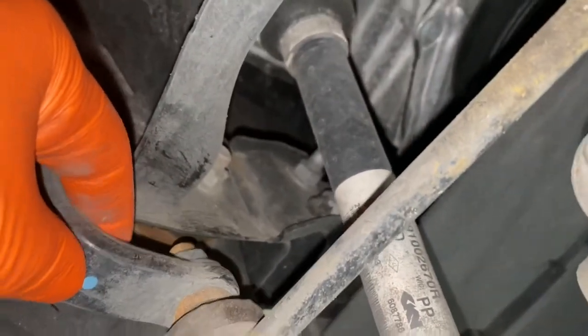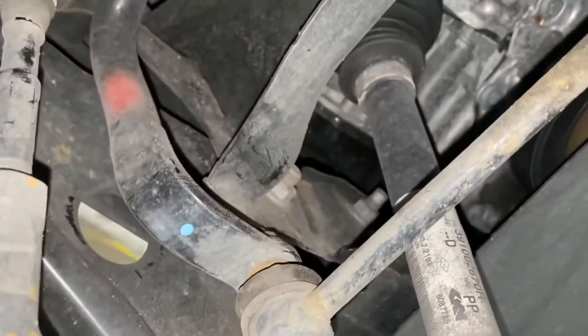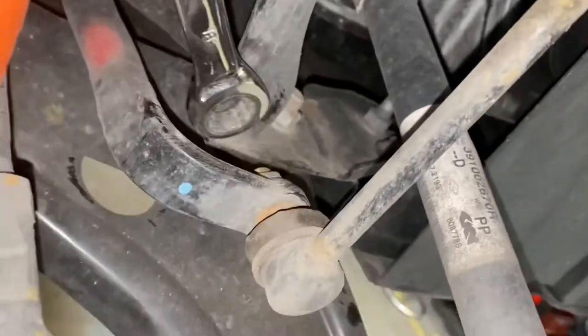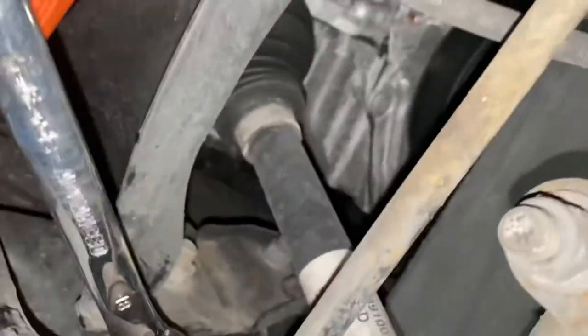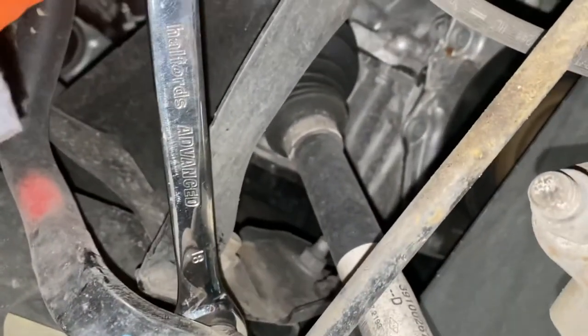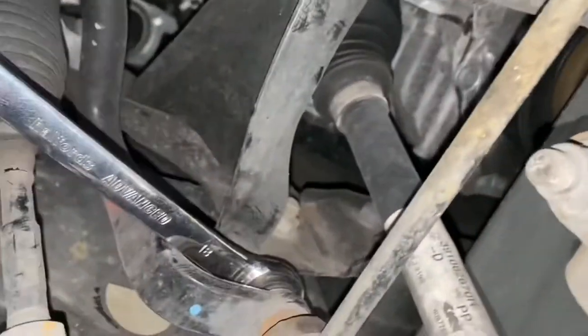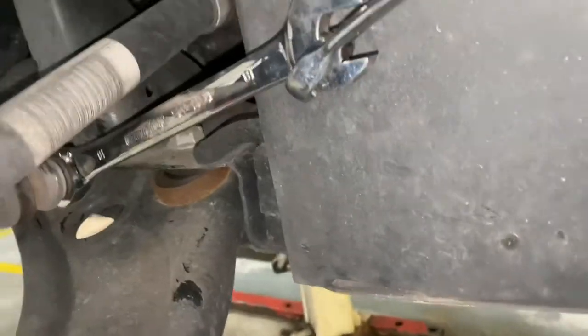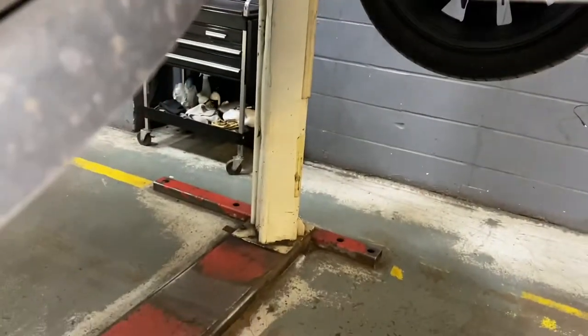As you can see, that one's not off — I need to get in there, it's a bit more tricky. I'm going to try and just use the 18mm ratchet to take that off. I have to put another spanner on there — you can see the subframe is in the way, so just got to be careful not to cut your hand on that bit. I've put the spanner around the other side and added another spanner just to give me extra leverage, just to pull it down.